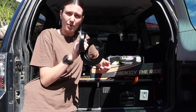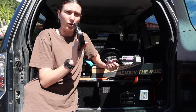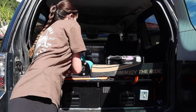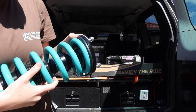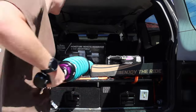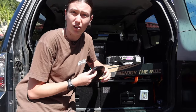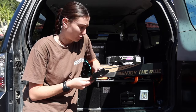And then something to keep an eye on is coil seats. You might want to check yours and you might need to buy new ones before you install it. As you can see, these ones are pre-assembled, so they've already got it sitting in there, so I didn't have to buy front ones, only for the rear. But my rear ones have been destroyed for a very long time. I've just been a little bit lazy and probably a bit naughty for not replacing them.